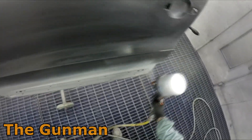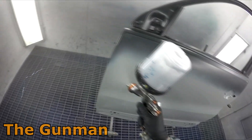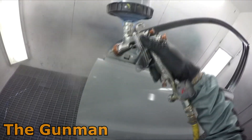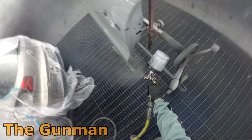What I did was do all of my edge masking, then threw a piece of plastic over the car, and now I'm doing my wet-on-wet primer. I haven't actually finished the masking on the car - I got all the edges done, and it takes about 15 minutes for this wet-on-wet primer to dry.